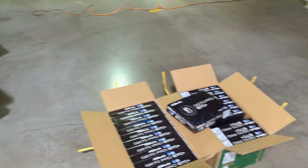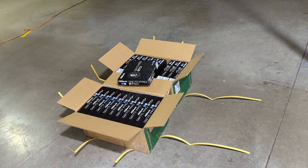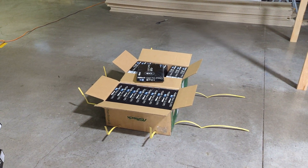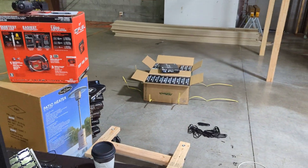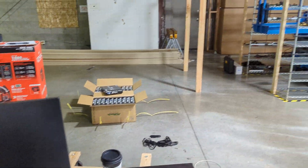For our setup, we have it planned out with two GPUs at the bottom, two GPUs on the right-hand side at the bottom, and 10 GPUs in the middle with good space so you can reach in and grab a GPU if it has a problem. That's 14 GPUs — but because these Q270s are only 13, we have extra space. For every 13 rigs, you have to build a 14th one, meaning if you're building 26 rigs, you could have saved yourself two more rigs with a 14-GPU board. That's an extra cost. However, unlike the B250 which had three separate power sections on the motherboard, the Q270 doesn't care where you plug in the USB riser — any port works regardless of which power section it's on, which is really nice when mining.